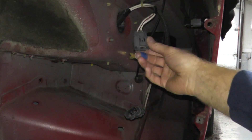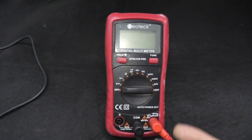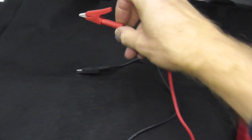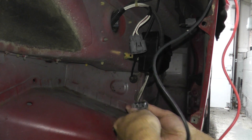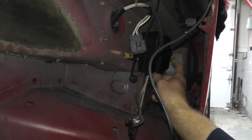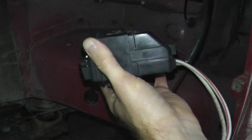So we know the fuse is good and the wiring running from this sensor to the fuse is good. Now let's check the sensor itself. Going back to the multimeter, we need to check for continuity — continuity just means two points make a connection. Look for the Wi-Fi hotspot symbol on the multimeter. Taking the leads from the multimeter, one to the left terminal and the other to the right terminal — we have continuity, which tells us this is in good working shape. If you have no continuity, you need to replace this sensor.